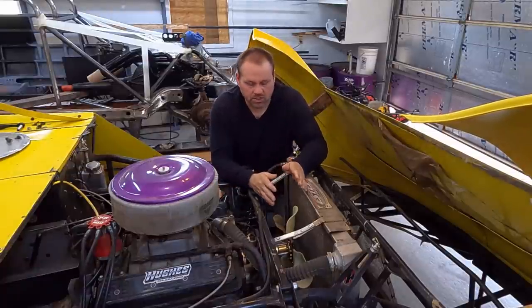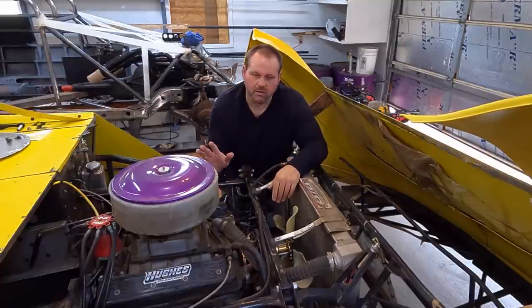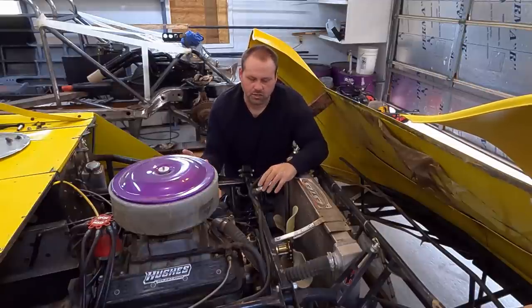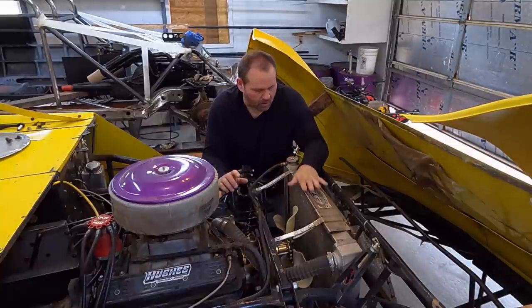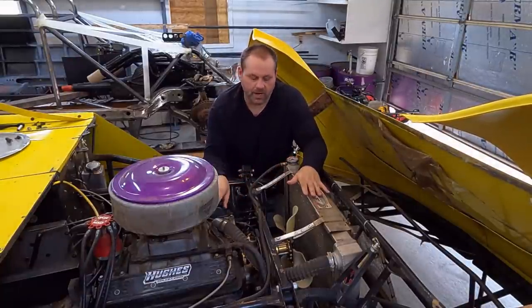I just want to show you where we're starting. With this car, they ran a feature where they ran 20 laps straight, and he was running like 240 at the end of the race. It's a 602, it's professionally been redone and gone through, it's tagged and sealed, the carburetor's right, the timing's right, everything's been done by professionals on it. The radiator is right on it, there's no issue with it. He's just not getting airflow through the radiator.